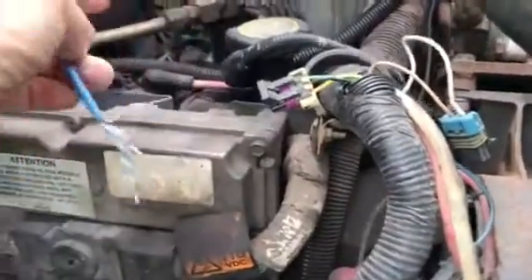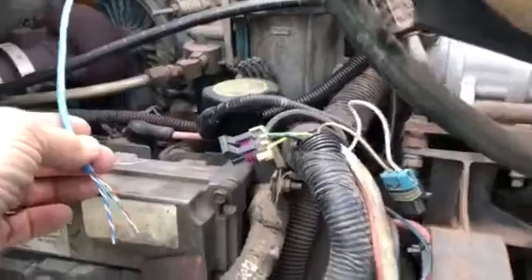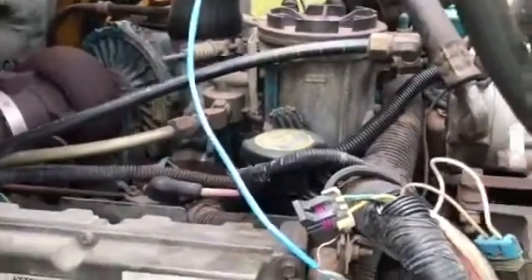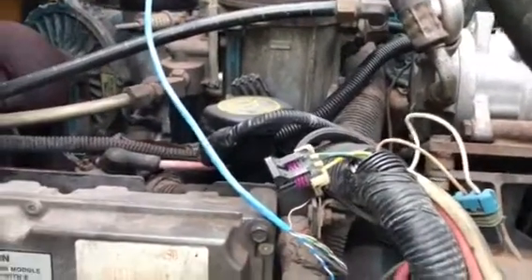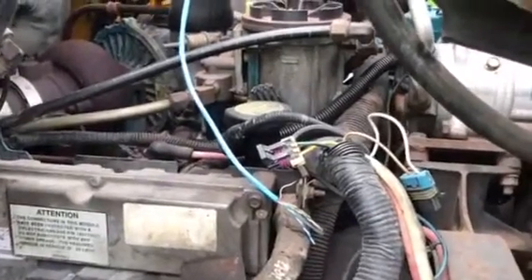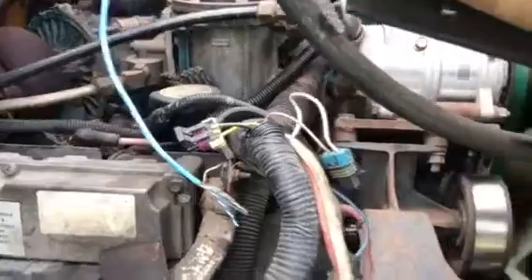In this video we're trying to connect the transmission to use the J1939 link from the ECM of the bus instead of using our little throttle box, because the throttle on mine is a little bit flaky. If you have a T444E or a DT466E engine and you're trying to swap to an Allison 1000 or 2000 like what I did, you have to get the throttle in.